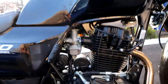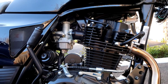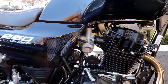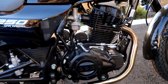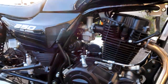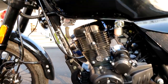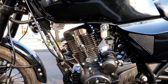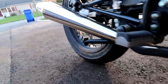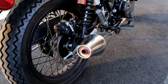It's kind of like the 250s you ride at the MSF riding course — small single cylinder bikes, very easy to control. It has 16.1 horsepower at 7,000 RPM and 13.5 foot-pounds of torque at 5,500 RPM. It's pretty weak, but it's still a pretty peppy bike — fun to learn on, fun to mess around on. It's an air-cooled, counter-balanced, single-cylinder engine with a five-speed transmission. It's got that chrome single megaphone exhaust with a nice exhaust note, which I'll demonstrate in a bit.